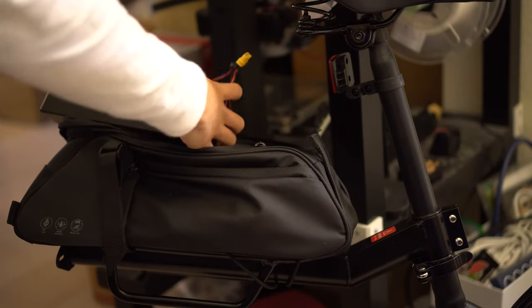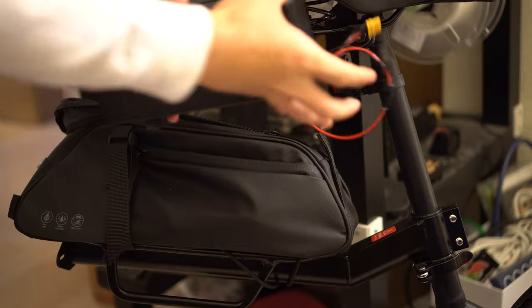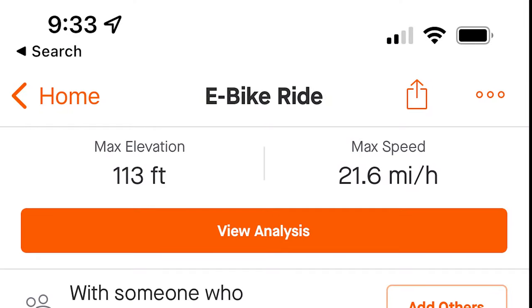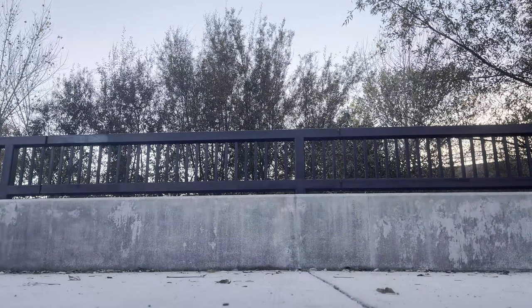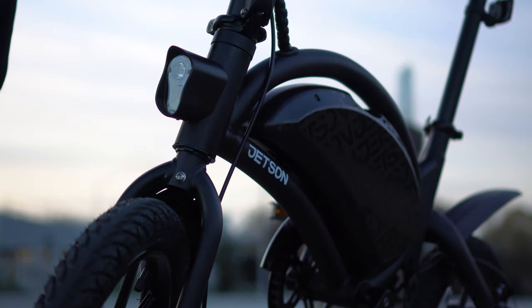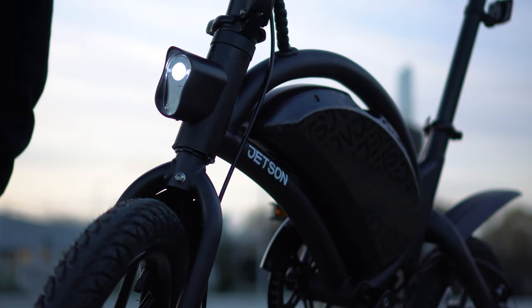After this hack, the bike is so much more enjoyable. I can go up to 20 and even 21 miles per hour on flat terrain, as you can see through my Strava app. This is really cool, makes the bike really fast, and you can always reset it back to the normal settings — just change it in the code from 19 miles per hour to 15.5 miles per hour and you won't have an issue.